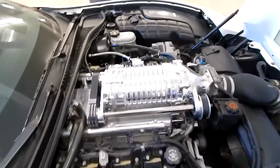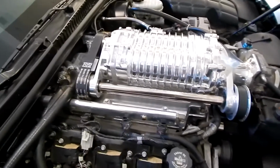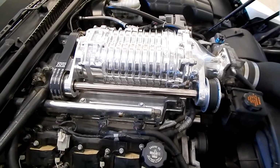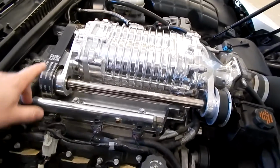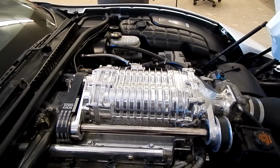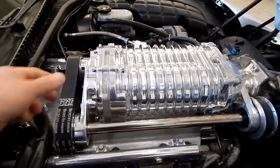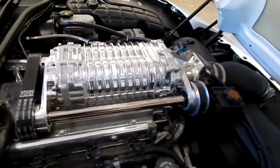Okay, so we're on the other side of the motor. We're going to just take a look at things to figure out how we want to go forth in actually removing this belt. I actually couldn't really find too many good instructions. Generally, the way these ship, when you get the kit, they actually ship with the belt installed. So I was able to dig around and find a little bit of information. And also, one of the big things was the actual tension. We're going to want about a 1/4 inch movement on the middle of the belt when we retension it.